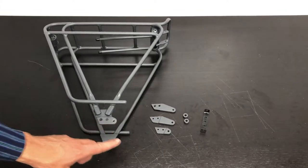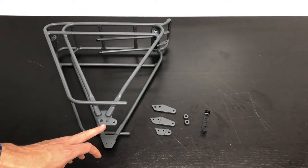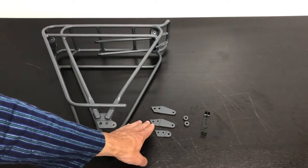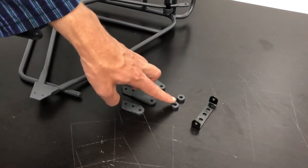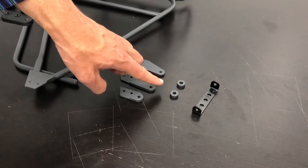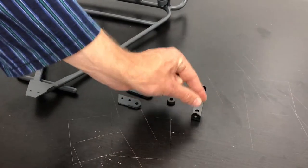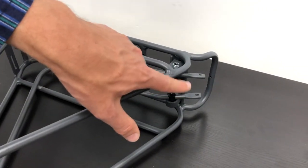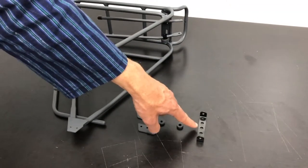Included in the rear rack are two sets of dropout mounts, one short and one long. These are to fit different bike geometries and also to increase rack setback if you have any heel clash. We also have two widened washers, which are to help fit different disc brake setups to clear the calipers. Lastly, we have an adapter plate for adapting the standard setup of rack mounting with two bosses either side of the chainstay to a single central boss, perhaps behind a caliper brake.